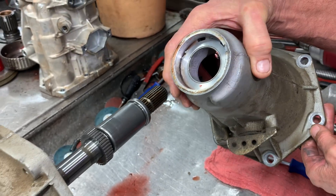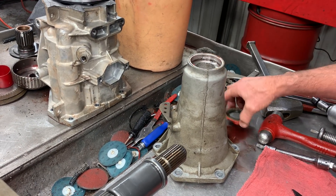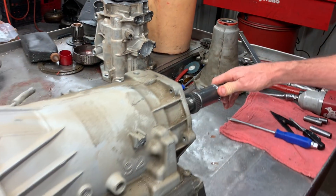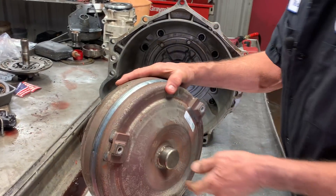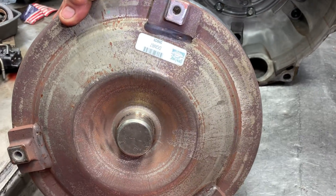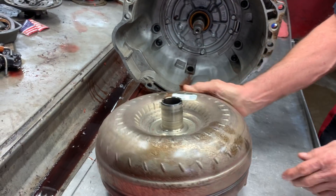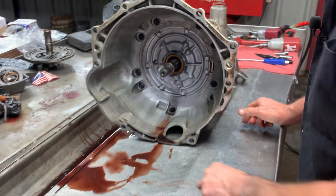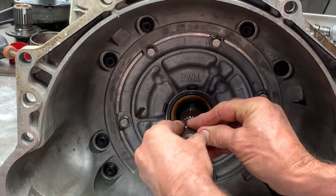It's been rebuilt before. It did have a new seal, but when I knocked it out, it almost fell out on its own. We always glue these in no matter what — that way it just secures them and they don't leak. It's got a rebuilt converter by somebody. It's hard to tell, but the fluid looks dark and it smells bad.